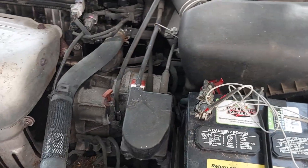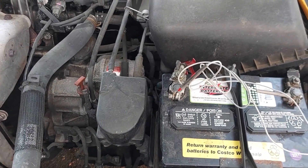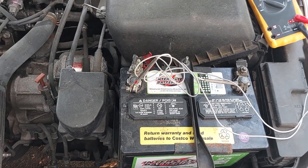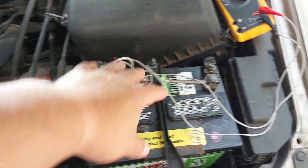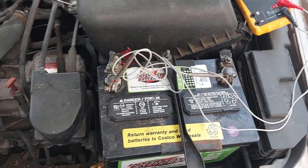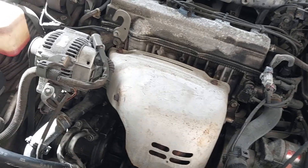It just literally felt like it was running on the battery. I revved the RPMs and the tachometer would jump up and then drop — it basically shut down all the accessories. I got home, cranked over the engine, jumped it, then got my multimeter out on the battery. Once I got it fired up and put the probes back on, I saw the exact same thing — basically at 11 volts, running directly off the battery, not charging off the alternator at all.